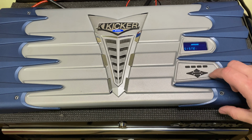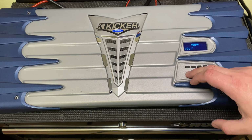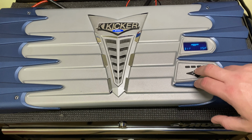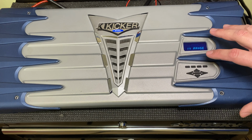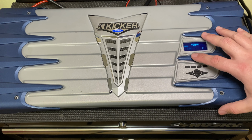You go through the system, the voltage now. It shows you voltage now. You can also see the minimum and the maximum voltage it's seeing. Just by going down, you can reset the amp, lock code, display, bypass the digital sound processor. You can set your gain range here. There's 4 different settings. It's very involved, and really, I don't have a full grasp on how to set this up myself, so I cannot show you exactly how to set it up. I just knew how to set the gains and be able to adjust up to 12 dB after you set it. So it's a very cool feature.